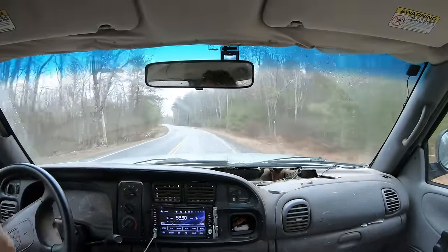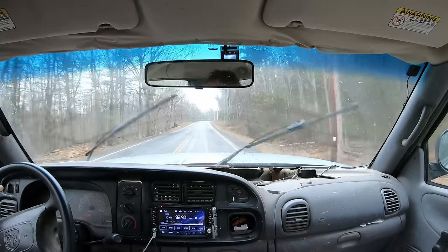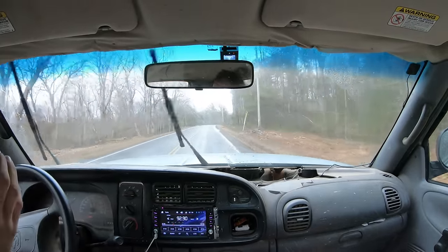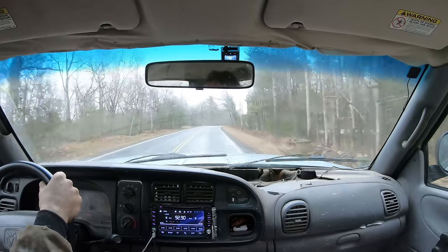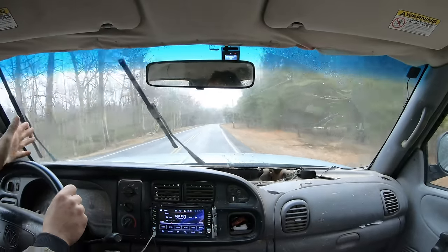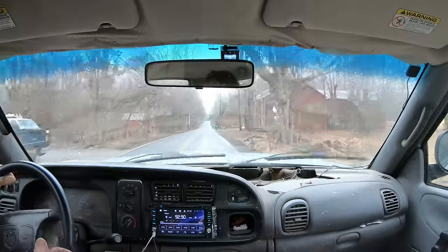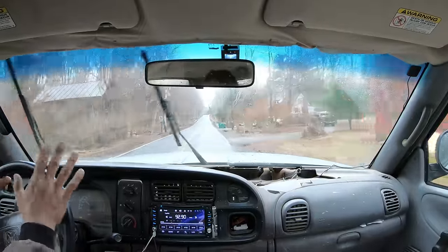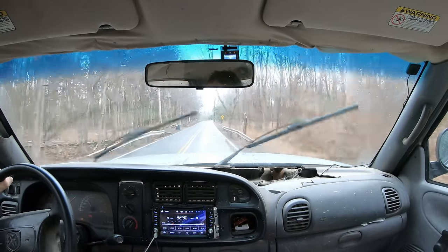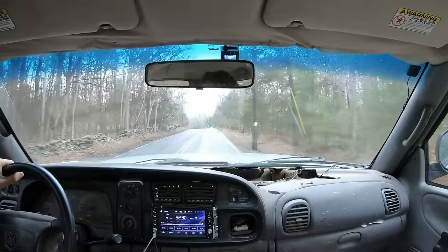Because what happens is usually the brake lines rust, and then people don't notice it. They shouldn't be made out of steel. That's the whole problem. And the problem is you get yourself an emergency braking situation where you slam on the brakes, and the brake line will burst because it's made out of steel, and then the vehicle loses brakes right when you need them. All right, so a real good test to see if the brake lines are good or not: when the vehicle is running in park, just stopped, stand on that brake pedal as hard as you can. That's when you want the brake lines to fail, when you're not moving. Then you can fix it and find out about it when you're not driving.